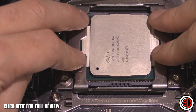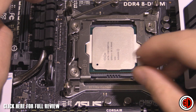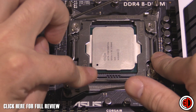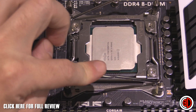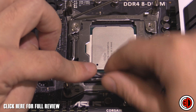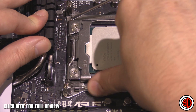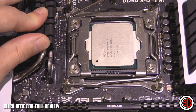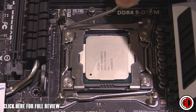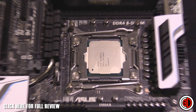That is what helps hold the CPU down — it's not on the silicon or anything. So the first thing we do is take this lever and push it down. You can see it's pressing on the end of the socket, starting to pinch it down — the socket is starting to bend and move, and the CPU is getting forced down inside. Push that down and it locks and latches into place. Then go for the secondary clamp, push it down, it goes on the inside and clamps in as well. And then that is your CPU fitted.